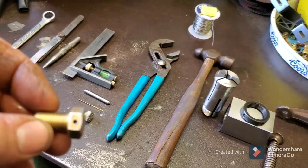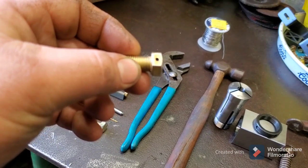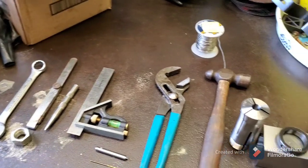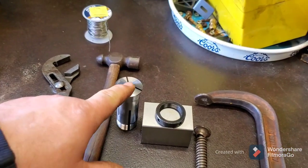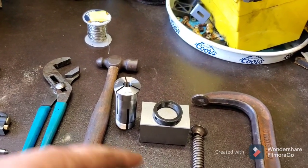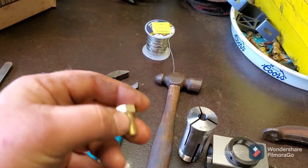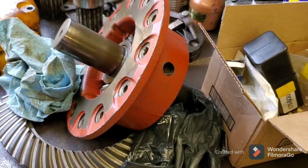Here's our tool layout. If you're not familiar with what a safety wire hole is in a bolt, it's a hole that goes all the way through so you can tie it up and keep it from moving. You find this a lot on race cars and aviation type stuff. I'm going to be using a somewhat unorthodox method — I use a collet block and a collet. I'm working with 7/16th size bolts; I need to do 12 holes for a differential carrier that the bolts keep loosening up on.